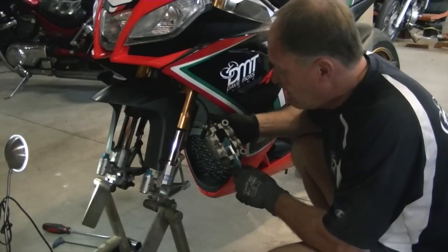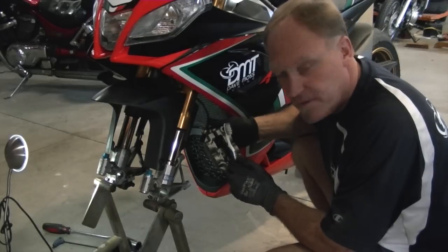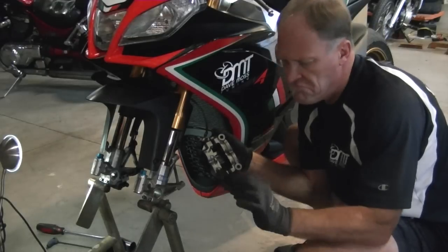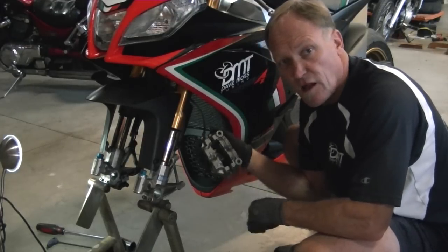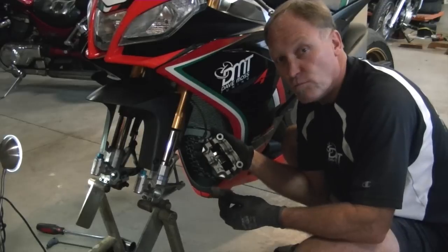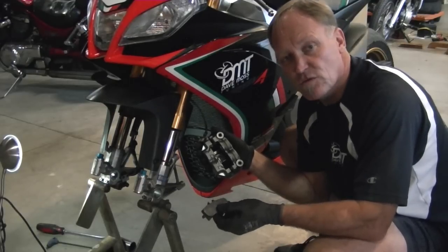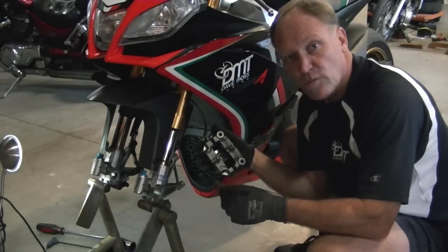Then refit the pads. When you've finished, take the toothbrush to the exterior of the caliper as well — that too deserves equally as good a clean. Now with the interior completely cleaned, we can go ahead and put our brake pads back in. There's plenty of meat on those pads. Don't look at them and say they're thin and put them back in — our lives depend on this, and so do other people around you. If your pads are marginal, change them now. It's a perfect time to do it; don't risk it. These go straight back in by hand. You should know your caliper and which way it reassembles. If you have brake pins, make sure you clean those and make sure they're nice and smooth. Don't grease them — you don't want grease attracting brake dust, which is corrosive. Just clean everything and put it back the way it came out.